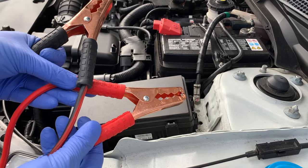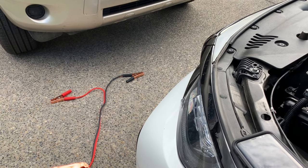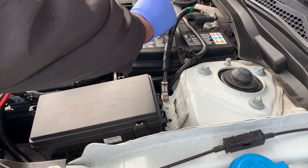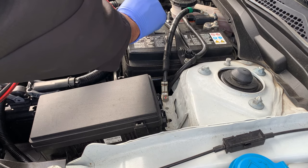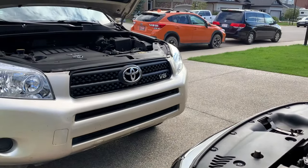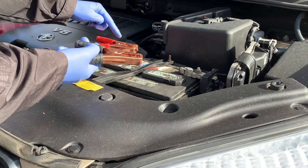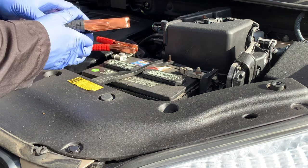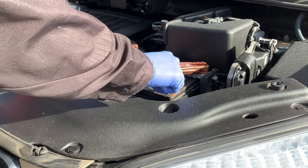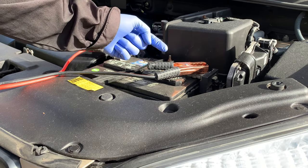Make sure these leads are always separated every time you're handling them. Even though there's no current right now, it's just really solid practice. Let's go ahead and connect the positive end to the positive terminal on the discharged battery, making sure you've got a really good connection that won't go anywhere. Now take the negative and leave that aside for now. Next, let's hook up the positive to the good battery — on the fully charged battery, we go positive to positive. On our negative or ground, we're able to use the post on the good battery, so go ahead and hook that up and give it a wiggle to make sure they're both nice and solid.